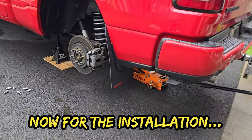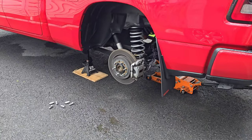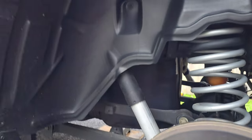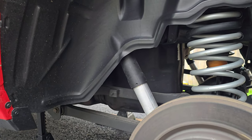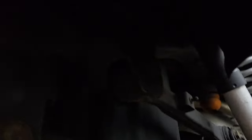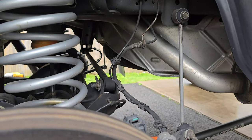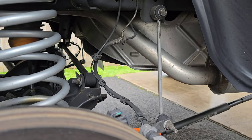The next part is pretty self-explanatory — go ahead and put the truck on jack stands and pull the wheels off. The liners don't have to come out, though I probably should have removed them to make the video easier. We can get up under the back side to get the top nut off for the shocks. Now let's put the Bilstein shock together.